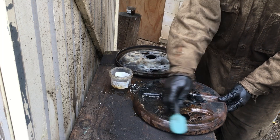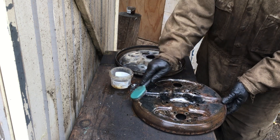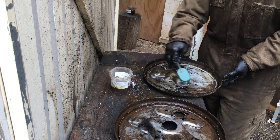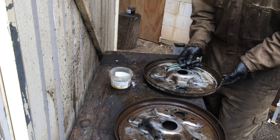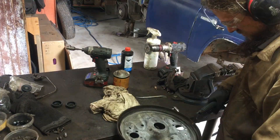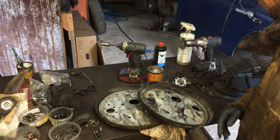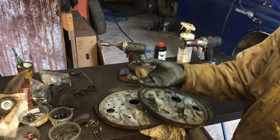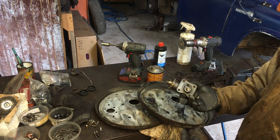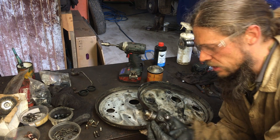I'm just putting this phosphoric acid on. I'd love to know, if any of you guys are chemists, what the optimum way to apply this is. My understanding is that it protects from further rust to some degree, but we're going to let these sit for a little bit to continue converting. We're going to put some fish oil on them soon, and I'm just going to put the rubbers back in so we can start bolting all these reconditioned cylinders back on. We've anti-seized the adjusters, and this is a blind cylinder here — that's why it doesn't have a boot.